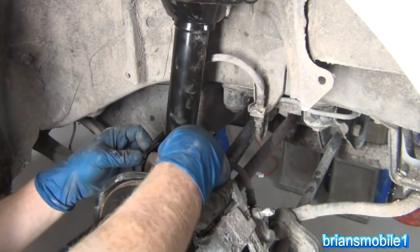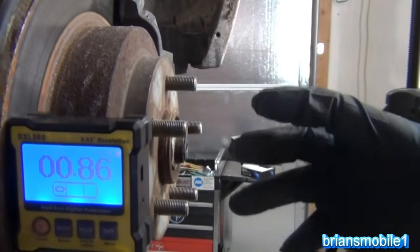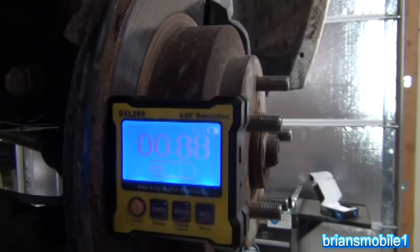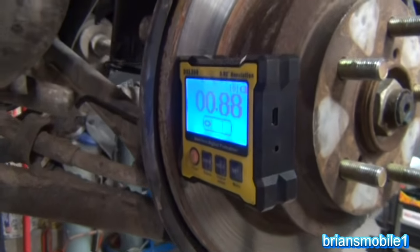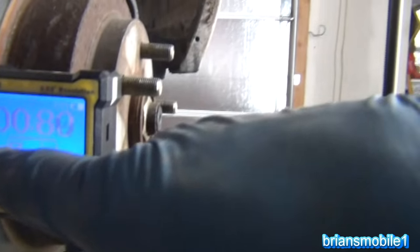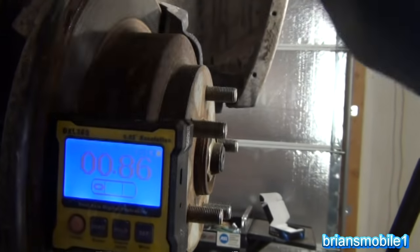So the next part we need to do is just tighten these bolts and we're good. Now if you'll remember we set the angle at about 0.60 — all this does is tell us to get it back to where it was. That doesn't tell us exactly where it should be; to do that you'd have to have the vehicle with some weight or something on it with the tire on. But this just gets us real dang close to what we had. We had a good alignment before so we just want to get the same number that we had before. This shows that it's high so it'd be positive camber — we'd probably want negative camber, just straight up and down. Due to the concrete and the lift and everything else, the number we're going for is 0.60.